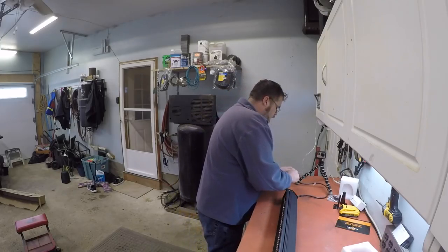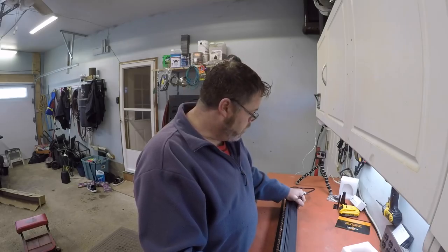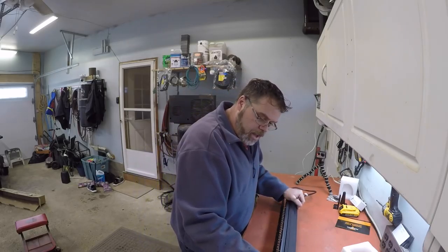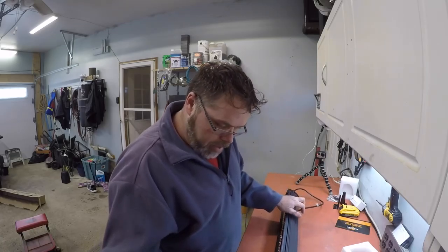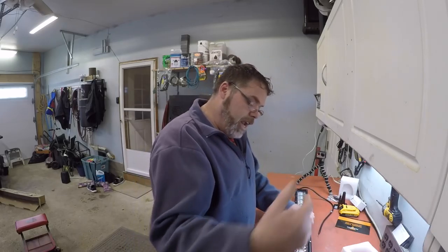If you're hooking this up and you do have to order the one that just comes with a wire like I have, make sure you run a relay on them. You don't want to run this direct to a switch because you'll melt the switch. If you're not sure on that, make sure you purchase the one that comes with the harness. The link's in the description, and I'll put the link for this one and the one with the harness too, so you know which ones are what.